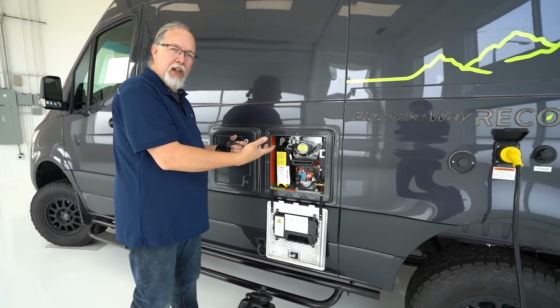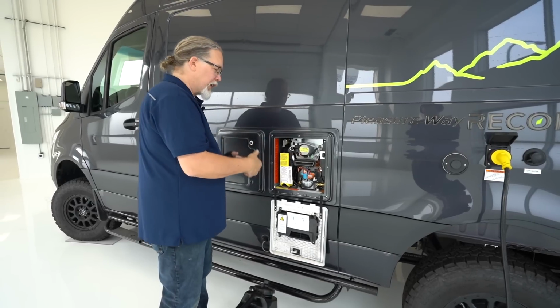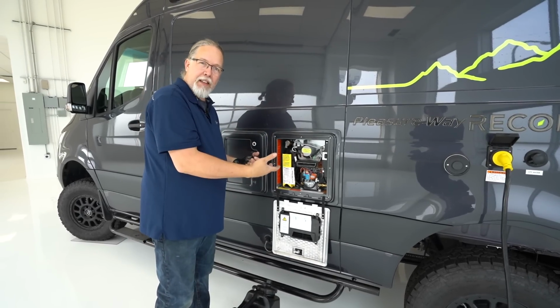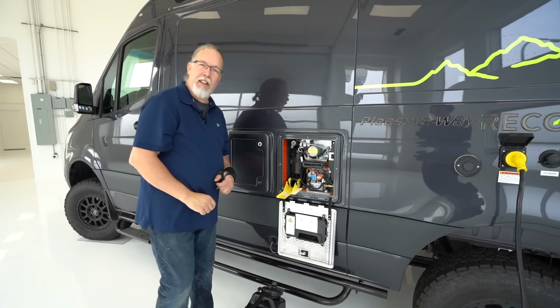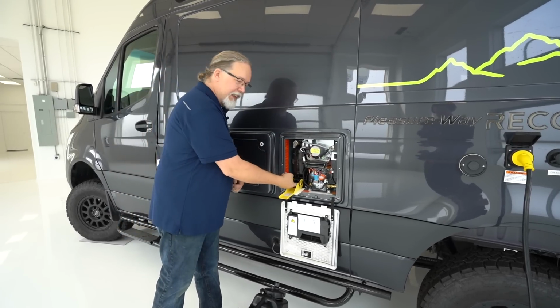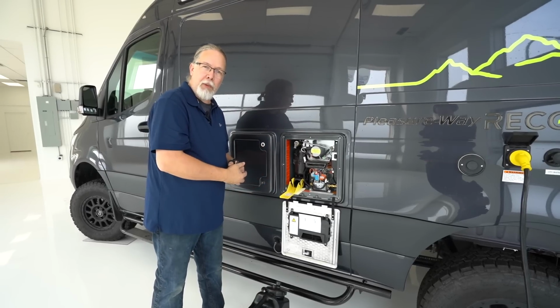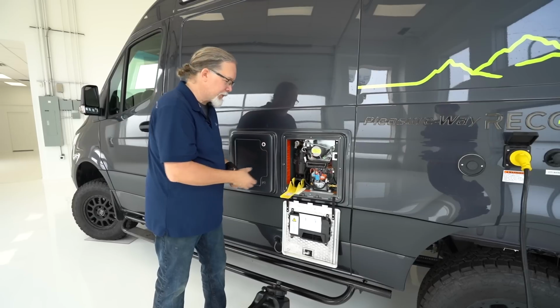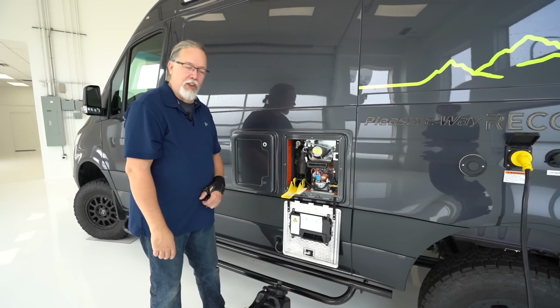So when you're winterizing, like I said, or not using the unit and you want to get the excess water out, you turn off the pump, open a tap to release the pressure, and then you pop this little yellow valve down. Normally there will be a filter in here. Again, it will come in your blue packet that you'll get from your dealer. Like I said, it'll just slide out and the water will just leak here onto the ground.